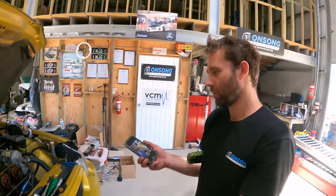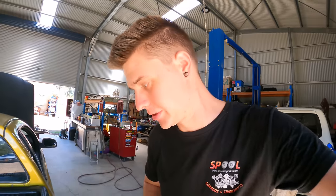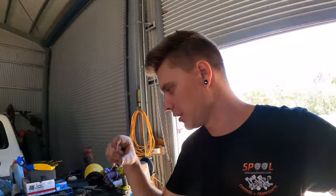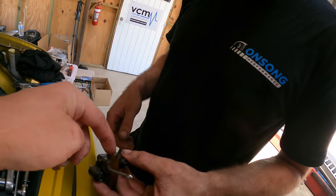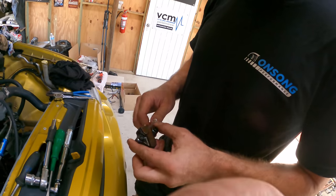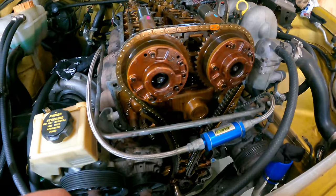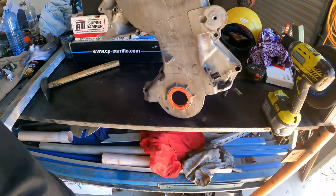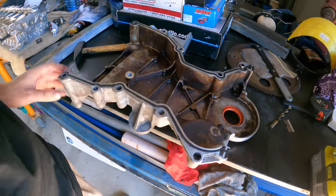The timing chain has four colored links - two orange or yellowish-orange links that line up with the dots on the top of the cams, another yellow-orange that lines up with a dot on the crank trigger wheel, and a darker link that lines up with another mark on the crank trigger wheel. When doing it in this situation, use a camera to make sure you have it lined up - parallax can be a problem when looking from above. There's also a trick with the Barra tensioner - you need to put some pretension on it before you bolt it up, otherwise it rattles.